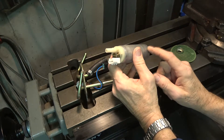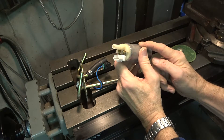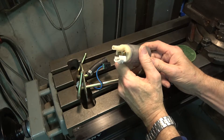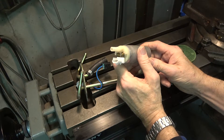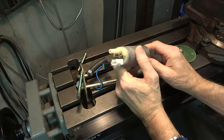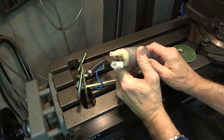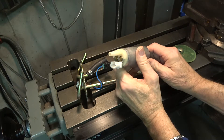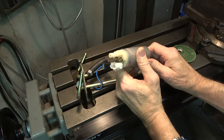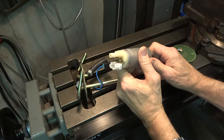There are no seals in this pump — the pump is completely filled with gasoline. It has a brush-type permanent magnet motor, and you might wonder: brush motors generally cause sparks, so why doesn't that cause an explosion? It just so happens that gasoline inside a tank has too high a concentration of vapor to be explosive. The air above the gasoline in your automobile gas tank is just too saturated with gasoline vapors to be explosive, so if there were a spark in your car's gas tank, it would not explode. That's the reason you can have in-tank fuel pumps like this.